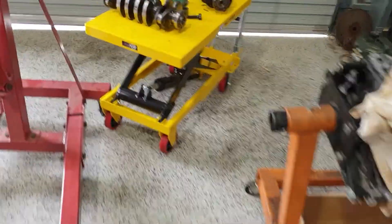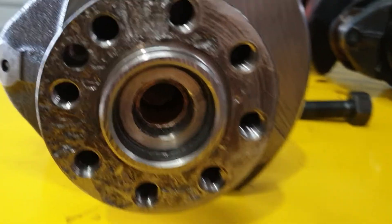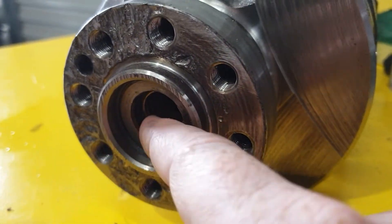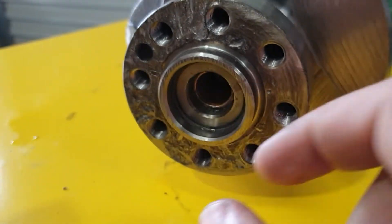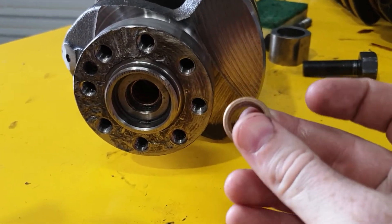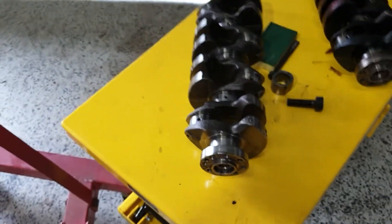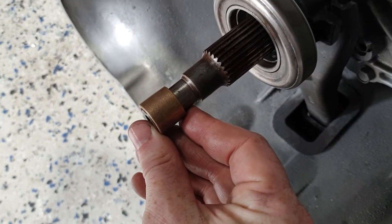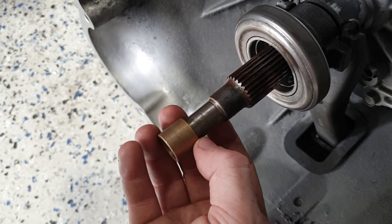Here are two that I prepared earlier. We have the spigot bush installed inside of the crankshaft — this one is fully installed to its maximum depth, recessed all the way back. There's an actual lip here, about 5mm, where the bush pushes in past this face deep inside. What I elected to do was simply install this bush so that it was flush with this face, kind of making up some of the difference. I've had the gearbox on and confirmed the engagement — the spigot bush has been sitting about here, which I'm pretty happy with because that's full engagement into the spigot bush itself. I'd prefer it to be a bit further back, but it is what it is.